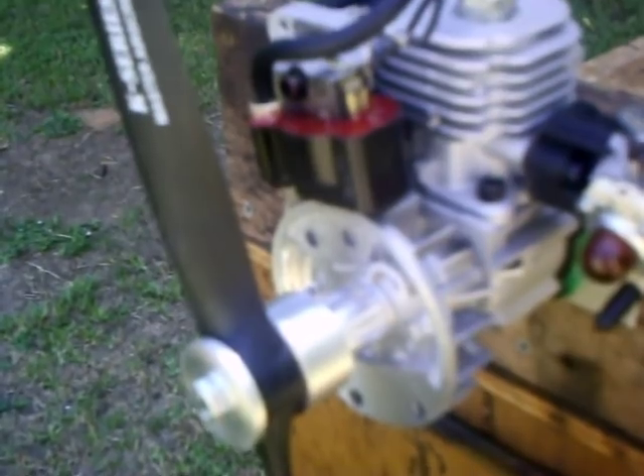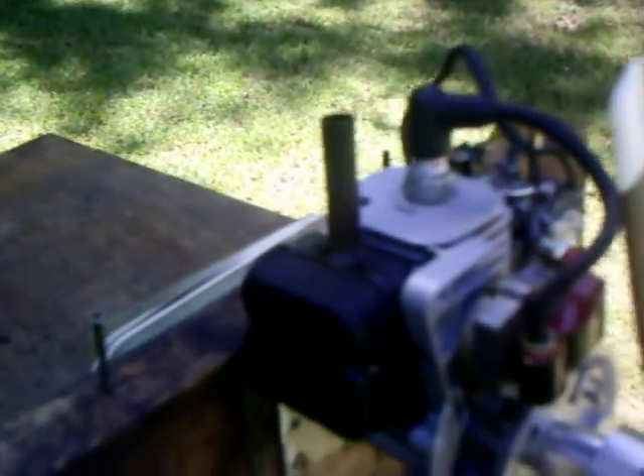It's a new hardened prop bolt. I trimmed the back plate on it, gutted the muffler, welded a pipe on it, and painted that black engine header paint. It idles at 1800 RPM forever. Hand starts so easy. You get 7000 RPM up top with this Master Airscrew K-series 15-6 propeller.